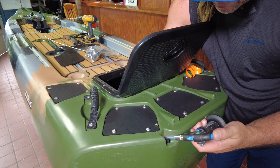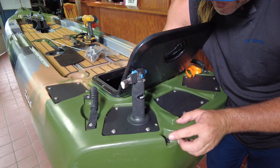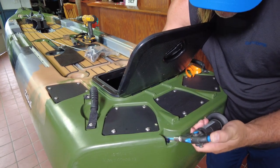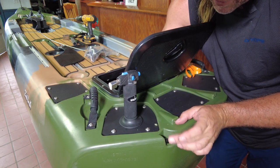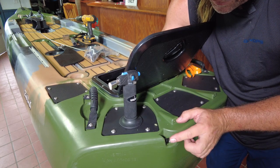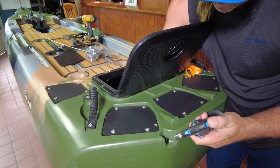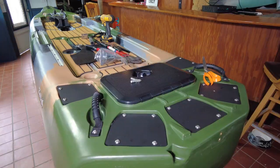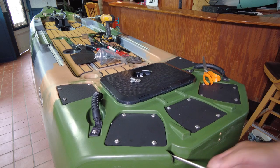You'll have a little bit — about an inch — sticking out. Now I'm going to go ahead and warm that up and start flaring that out. It's okay if it's got a little gap — don't try to press this all the way up against there. That gives you a little leeway so that you're not pulling the cable so hard that you end up jamming this thing back inside and having to redo everything. So now that that is finished, we're going to go ahead and put our cable through our housing.